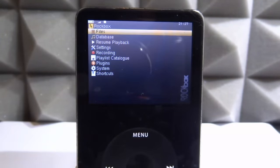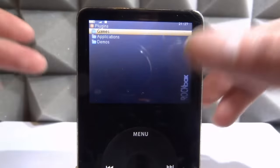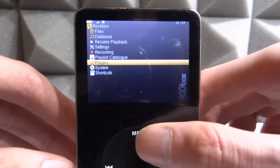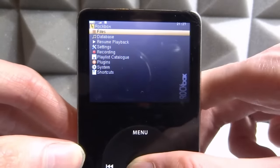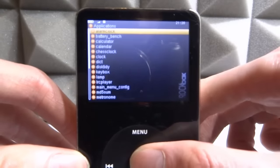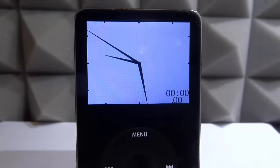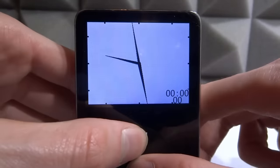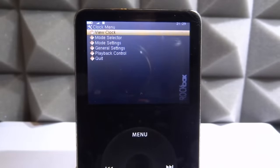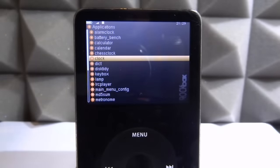Once you're off your computer, your iPod will be on the Rockbox operating system and will go straight to the Rockbox main menu. It works just like the normal iPod OS except with loads of cool new features — you can browse files, use plugins, games, applications, demos, recordings, and more. The main thing you'd want is the plugins section. For example, going into Applications you can open the calculator or calendar — see, the calendar works fine. To get back to the Rockbox home screen, press the Menu and middle button at the same time. That will either bring you back to the Rockbox menu or to the app's own menu where you can scroll to Quit.